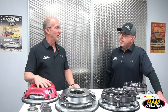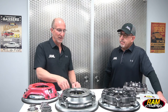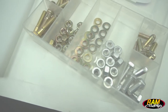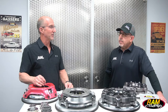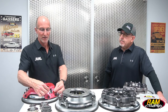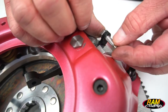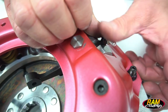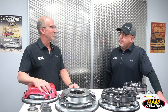The counterweight adjustments are a little different — they use these little sets of weights or nuts and bolts to create counterweight and add to the clamp pressure of the lever as the engine spins. It's dynamic: it's going to accelerate and clamp harder at higher RPM. By adding just a few grams to the end of this lever we can tremendously affect the holding power of the clutch, and as that engine RPM accelerates up to the shift point it's going to keep the clutch nice and tight, locked up on the gear change — hopefully just enough to make a nice smooth run.